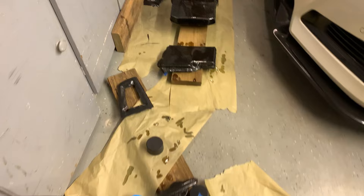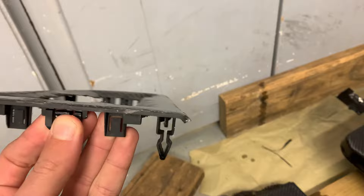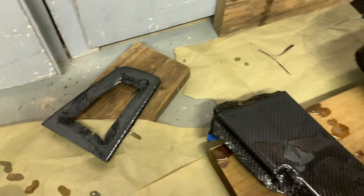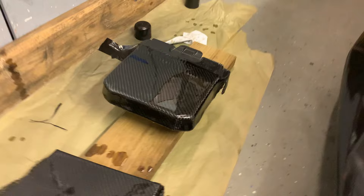It has been 24 hours and all of the parts have cured, so now it is time to sand them. But before I sand them smooth I'm going to cut off the edges - you can see I've already started on this part. That edge right there is flush with the plastic because I first cut it with scissors. For long pieces I cut off with scissors and then take a blade and cut it right up next to it. So once I sand I can sand down the edges to make them smooth, and then when I put on another coat of resin it'll wrap around the edges and smooth it all out.